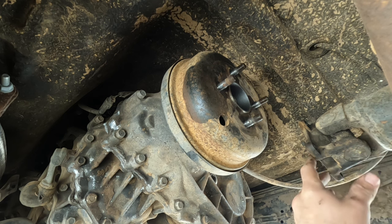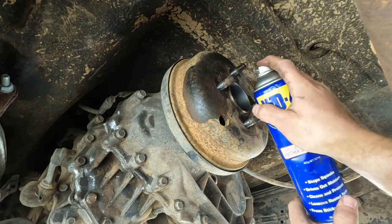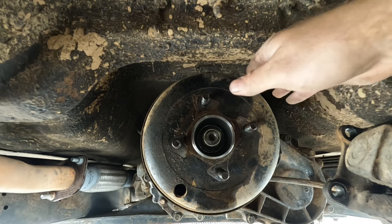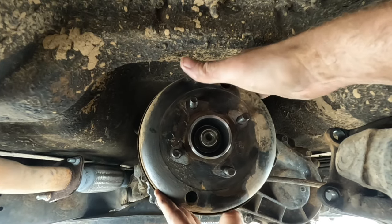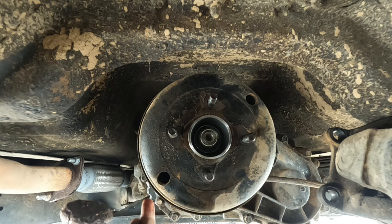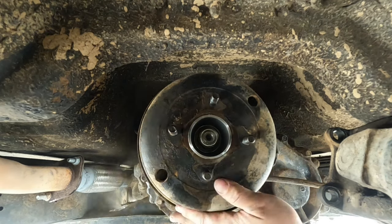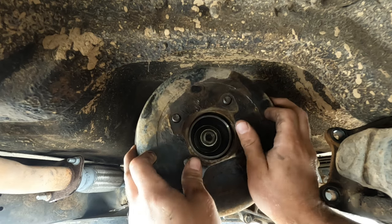You can take that shaft completely out if you want. Now we'll spray some WD-40 just around the handbrake assembly. With the handbrake released it spins around nice and easy. Trying to get the drum off is going to be our next drama. Because we've got it lubed up, we'll give it a tap with a soft hammer or copper hammer — even a heavier hammer, but just be aware not to damage or crack it. Just hit it in a few spots to free it up. So that's freed it up — she's come off.